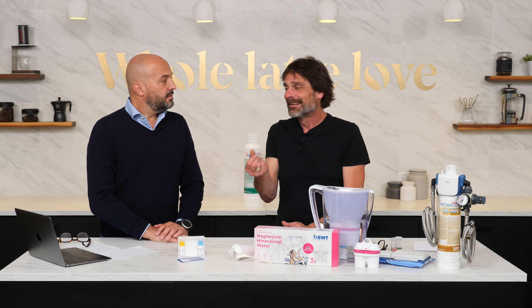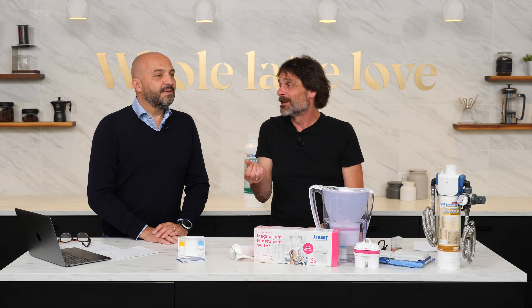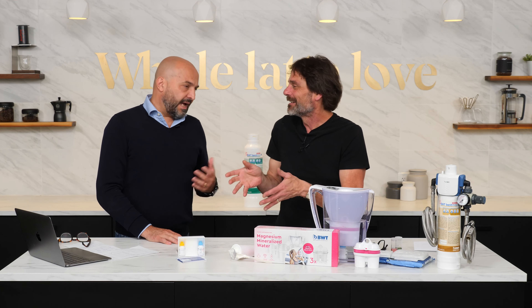You don't want that. We've had a couple of espresso machines come in that did use polyphosphate softening. You open up the boiler and find this snotty goo in the bottom of the boiler that does not look appetizing at all. That's what you find inside after a long time working with polyphosphate.